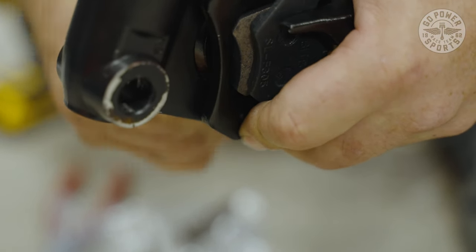As you can see, it needs a little bit more bending going on. So we're going to bend it a little bit more. And as you can see, now it's fitting properly in front and back. Now we can add our bolts, which I add on top. I hold them down, put this underneath, and then I can hold my fender up and add the bolts. Add the nuts to the bolts. These are 10 millimeter nuts and bolts, so you just need a 10 millimeter ratchet, 10 millimeter socket. Snug them down. If you tighten them up too tight, this fiberglass fender will crack.